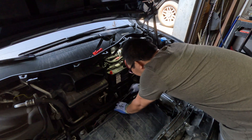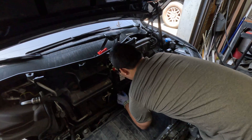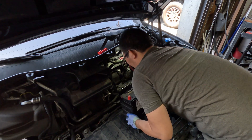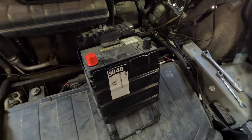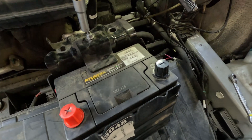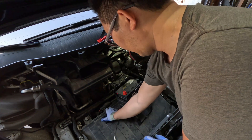Finally, we need to remove the remaining two bolts that secure the tray to the chassis. These two bolts are recessed within a rail — you can break them loose with a socket and then unthread them by hand. With all four bolts removed, you should be able to remove the battery tray and the battery. In order to free the battery, you'll need to rock it up and backwards. Remove the 10mm nut that secures the battery tie-down, then simply slide the battery out and replace it with the new one.